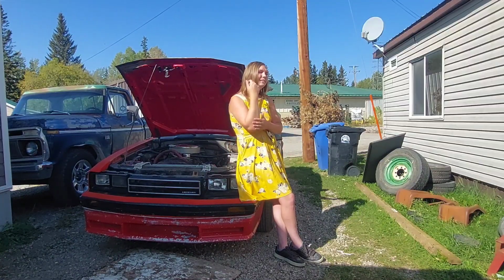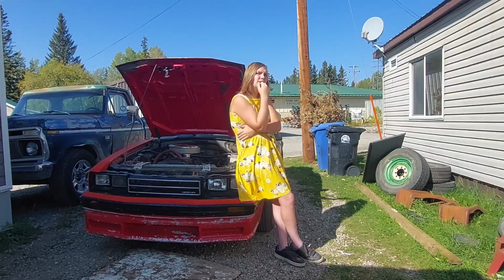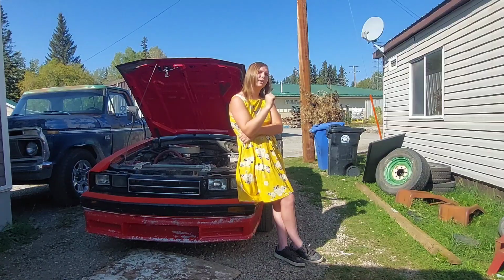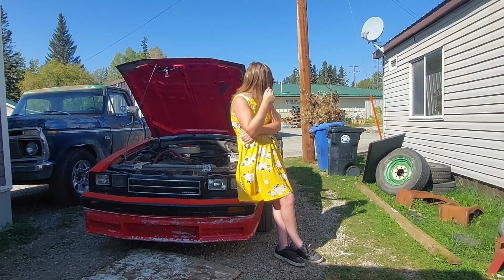But yeah, anyways, you guys will see the picture of that engine on here, and we'll figure out how to run multiple carbs, because that'll be a new adventure for me. I can set up one carb, sure, but setting up three? I think Roy Marco is going to become my best friend with that, and I'm thinking of running it with Carter YFAs off of a Ford 300. I've got one, I need two more, so I don't know, we'll see.